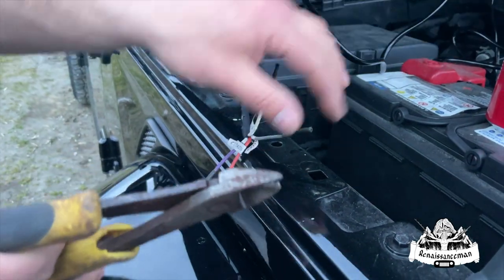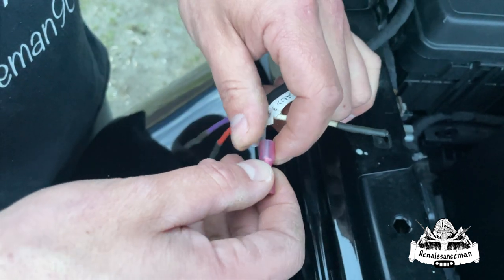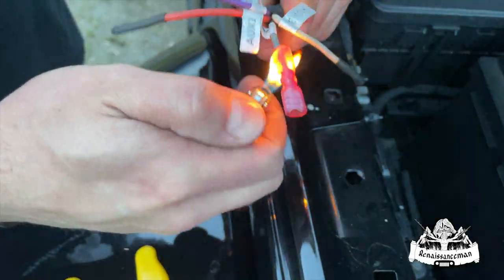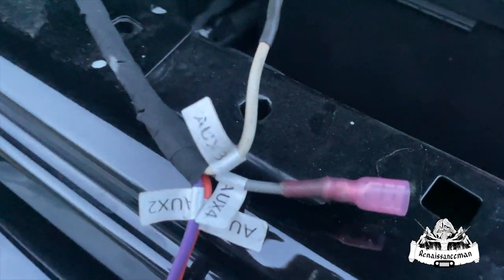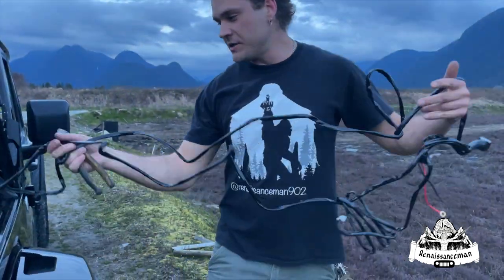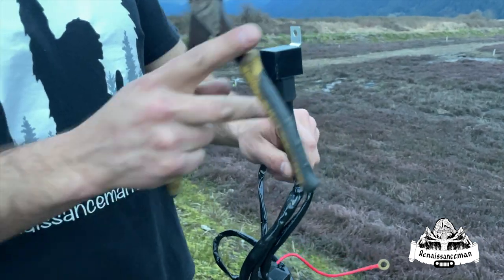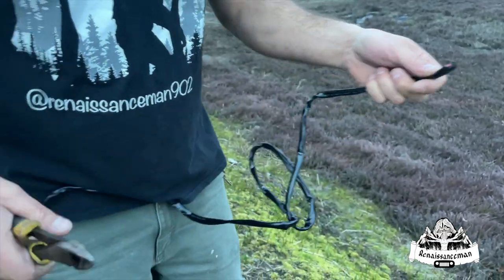We're just going to cut it off — we got our battery disconnected of course. So we got it on there and we're just going to crimp it. Now we're on the driver's side here, we have all kinds of cords. One of these is hooked up to each pod. We have way too much stuff that we don't need — there's a fuse here, a battery hookup. We don't need any of that stuff, we don't need this relay thing. It's all on the auxiliary switches, so we're just going to cut all that stuff right off and get rid of all that mess.